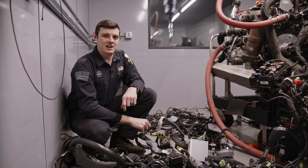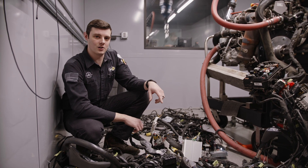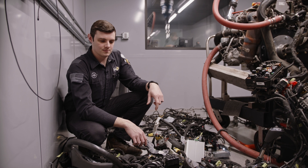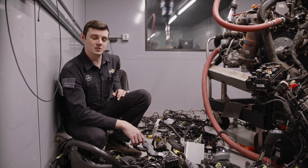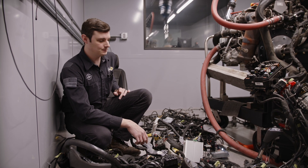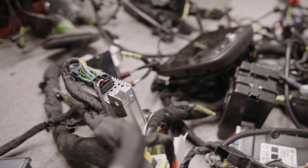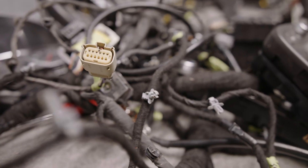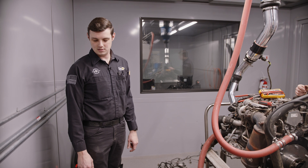We've got a little more noises going on now than we had earlier. Now that the trans is finally hooked up, we're still fighting trying to get our harness to recognize that it's in park, so that we can power into accessory mode fully and read the transmission and the ECM, and hopefully try to start the engine. We've got to plug in a couple more modules — the fuel pump and the power steering rack, which has the module built into it. We think that might have something to do with how the powertrain modules communicate, and without one of them it kind of shuts down the rest of them.